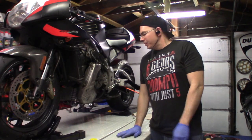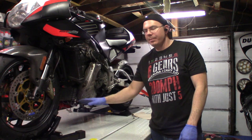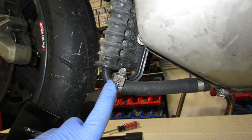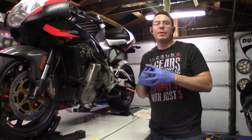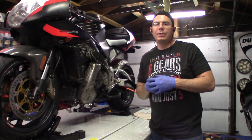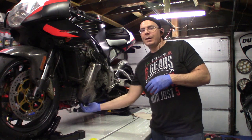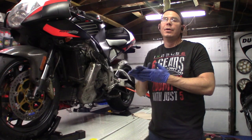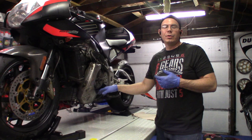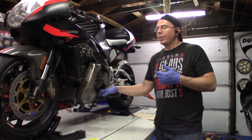There are a couple different ways to change this oil. First thing — always remove the oil fill cap so you get air into the system. Some people do not drain the oil cooler, but I actually do. I use a stainless steel hose clamp instead of a band-style clamp. The drain on the oil tank reserve will be underneath. There's actually a copper washer on there you really want to replace. Then remove your oil filter — drain the tank, drain the oil cooler, and pull the oil filter.